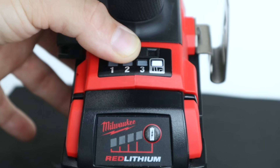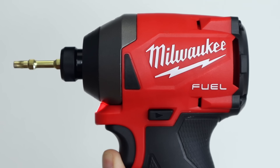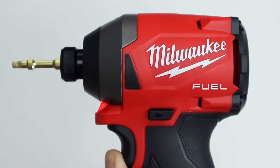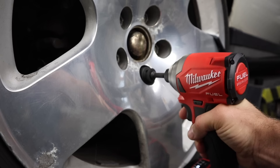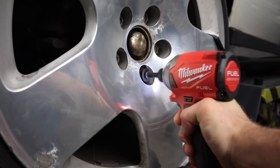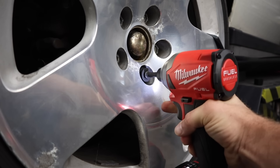I also think if you accidentally press that button, you might feel like your impact has a trigger delay, but that's not the case — it's just on the wrong setting. If you switch it to any of the other settings, especially three, which is max speed and power, you won't experience any kind of lag. You can set it to one for interior work, or jam it up to three for heavy duty jobs. I did test this on properly torqued wheel bolts torqued to 90 newton meters, and it did take the wheel bolts off. I probably wouldn't buy this tool with the intent of taking wheels on and off all day long — it just felt like the tool worked a bit harder than I really wanted it to for that application.